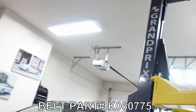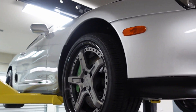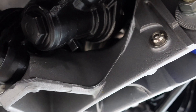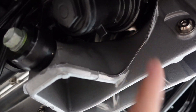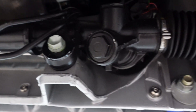I decided to get the car up on the lift and wash the car — just wanted to clean it up. I got to the beach and did a half-ass clean, so now I've got it up on the lift. I do have a power steering leak from the rack — it's very minimal, right here. I painted all this, and wiping it so much with brake cleaner has wiped off the paint. Eventually I've got to replace the rack. It's expensive for something you can't see, but I do need it.